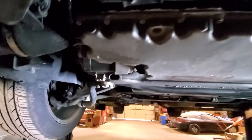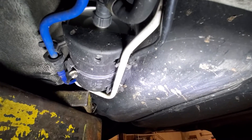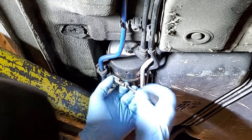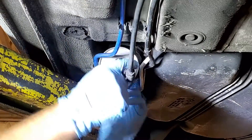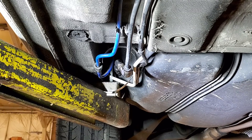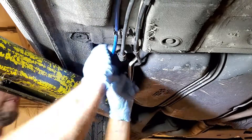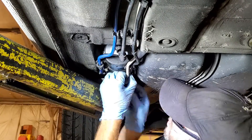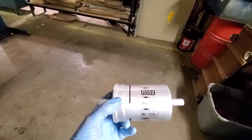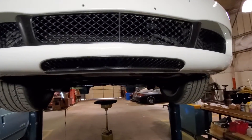The oil is drained and we have the new oil filter on. Now let's move to the fuel filter. It's pretty straightforward to take this thing off — all you need is a flat-head screwdriver to take that cover off, then use a flat-head to take off the quick-disconnect lines on either side of the filter. Here's the old fuel filter — it has roughly around 2,500 miles on it. I'll take this apart in a minute, but first we're going to continue on with the maintenance: take the wheels off, inspect the brakes, and rotate the tires.